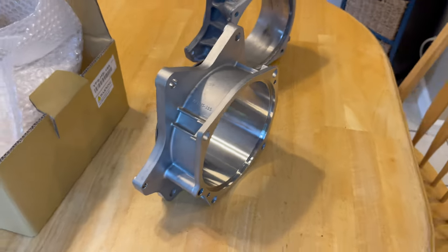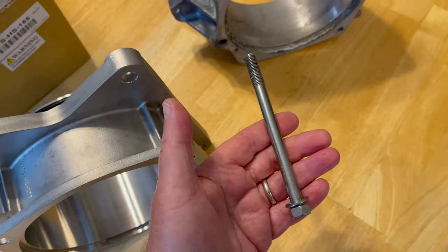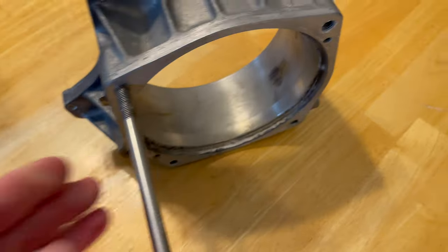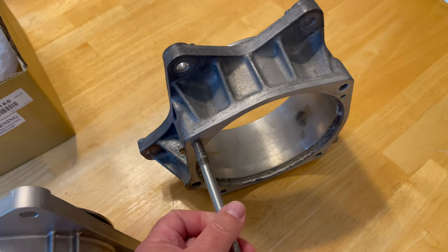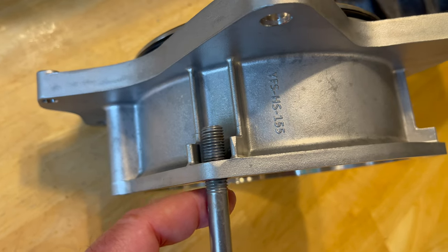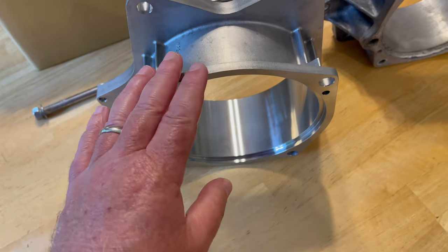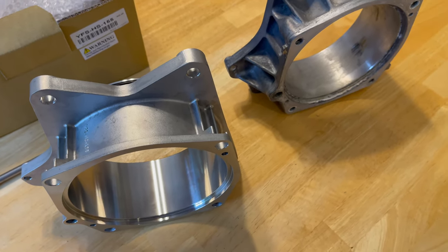What I'm not crazy about is the bolting. You can see right there there's a notch for a nut. This is the Yamaha OEM bolt — a 10-millimeter bolt with a 1.25 thread. On the OEM housing it goes into these slots; it's pre-drilled and encased — you don't see the back of the nut. But on the Solus, the bolt fits through and then you're required to take the factory-supplied nuts and attach them to the back of the bolt. A little different style, but more importantly, years and years of use is expected out of this because it is all one metal.